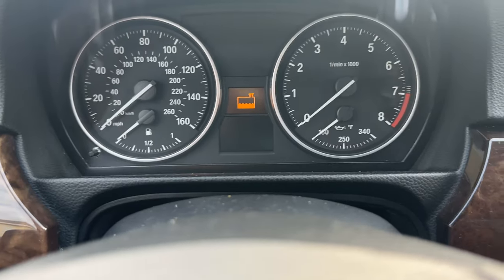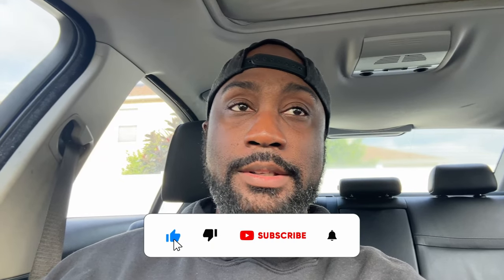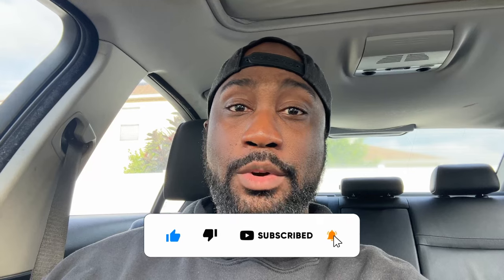Next video I'll tackle this warning — it's telling me the cooling level is low. The cooling level is not low though; I checked it, drove it around, did a pressure test on the whole system — no coolant is leaking. More likely it's just the sensor. I should have picked one up at the junkyard today. I think I have a sensor in the garage somewhere so I'll swap it in. After that I'm going to track down what's leaking — more likely the valve cover gasket. I've seen a little weeping and you can smell it a bit. Also going to check coil and spark plugs.